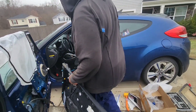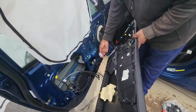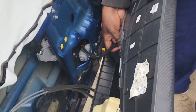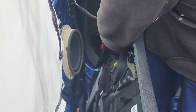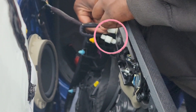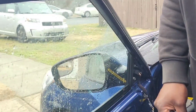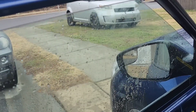You always want to make sure the window works first. We already got the motor plugged in — we're going to connect this in and connect both of these two at the top right here. We're going to check to see if the window's actually working. There it is — we're going to let the window up, we don't need it down anymore. So I'm going to unconnect all of these connections.